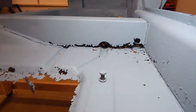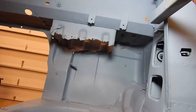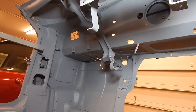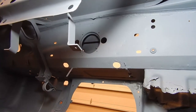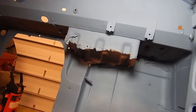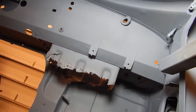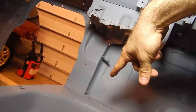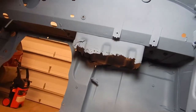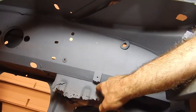Here's a close-up of the floor area — this piece is chewed out and chewed up on the top. But inside here and up underneath the dash, everything's nice and clean. You can get a good look at how everything looks under there — the structure of how the dash attaches. That hole back there is where the motor goes for your defrost blower and heater. You can also see where some of the rubber grommets were left on — it's kind of interesting when you take an entire car apart how many little things you leave behind. Little rubber pieces, clips, even a bolt. Then back to the problem area: going back to where water pools is our battery tray.